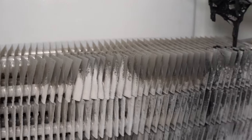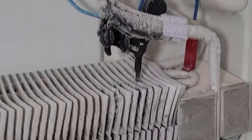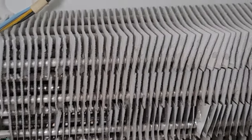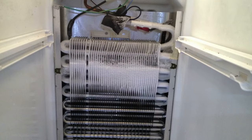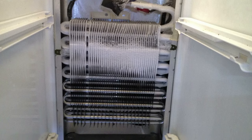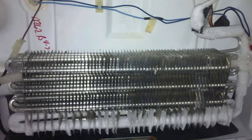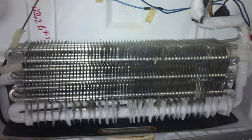Here are a few different frost patterns you could find behind these coils. Proper looking coils should have a thin or medium layer of frost that is uniform, like this one. If your system has absolutely no frost at all, then either the temperature control isn't working or you pretty much have no refrigerant in the system. If the frost only goes to a certain length of silver tubing and then suddenly stops, you may likely have a low refrigerant or sealed system issue.